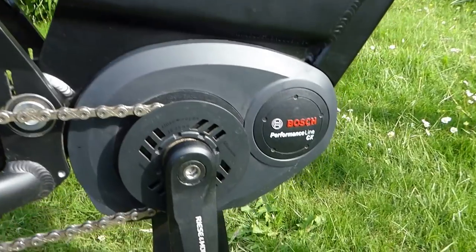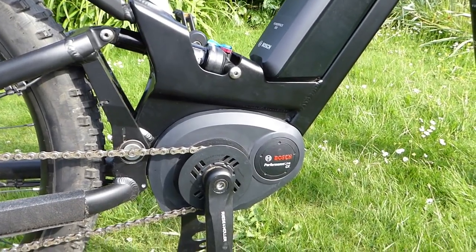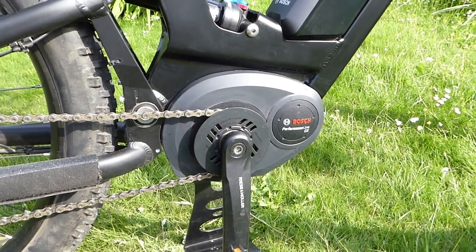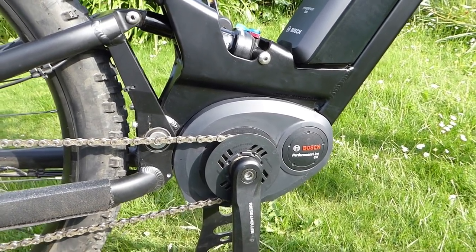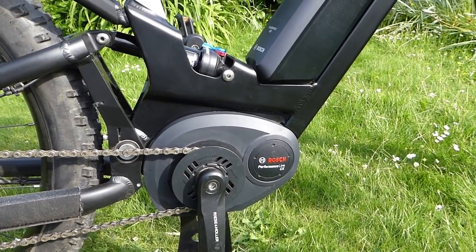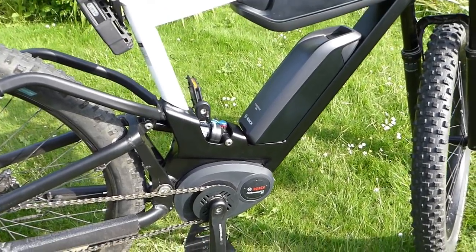Taking a look at the middle of the bike, it's the most powerful mid-drive motor option from Bosch: the Performance Line CX motor. We've been using it for pretty steep mountain bike off-road riding. We haven't used the top turbo setting at all — mainly on Tour, Eco, or Tour on the lower two settings, and occasionally on the EMTB setting, the third level up, for very steep rocky climbs. With the Rohloff's low gearing helping maximise the torque — claimed at 75 newton metres — there's just bags and bags of power to spare with that excellent mid motor.